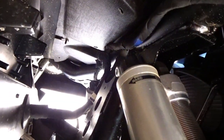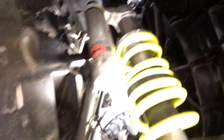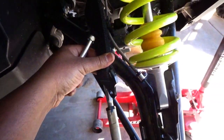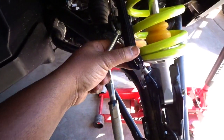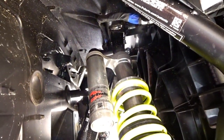All right, so we're all in there. The new bolt, washer, spacer setup is all back in there, running from back to front. At this time you can tie down and torque down the top ones to 40 foot pounds. It's going to be a T-50 on the rear, and then an 18mm on the front for the new nut. Just leave this bottom one hanging until you put it back on the ground, and that way we can tighten up the bottom half and it'll be set.